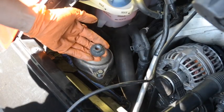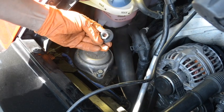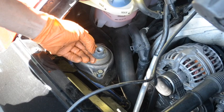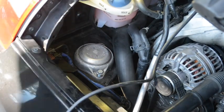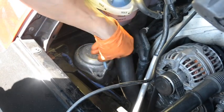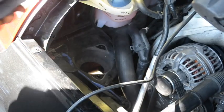The 18mm nut is washerless. Once you put the Wevo mount in, this gets torqued up to 60 lb-ft. You remove the two 13mm bolts up here, then go ahead and pull out the motor mount.